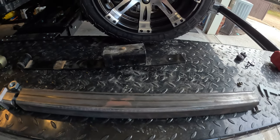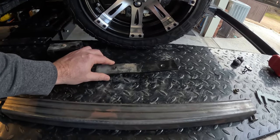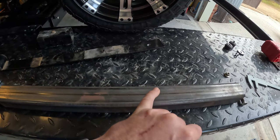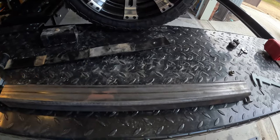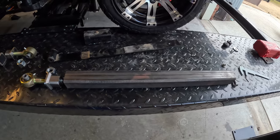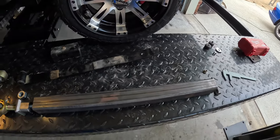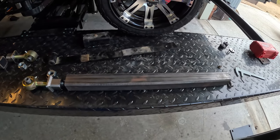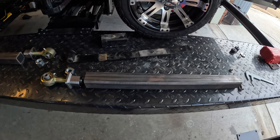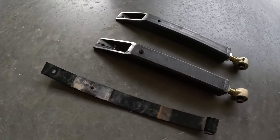We'll cut at an angle on the bar - I'll show you what it looks like when it's done before I put it in. We'll also unbolt and bolt it on here, as well as drilling a hole through the bottom so the axle seats into the square tubing like it's supposed to. I might have to grind down the inner edge just to clear the shock, but we'll cross that bridge when we get to it.